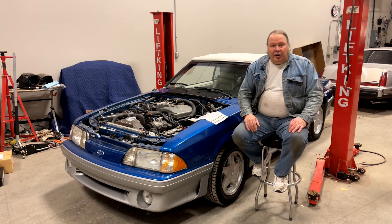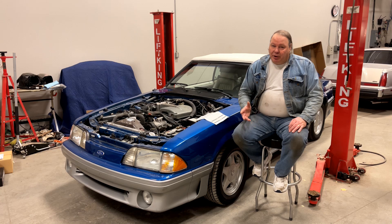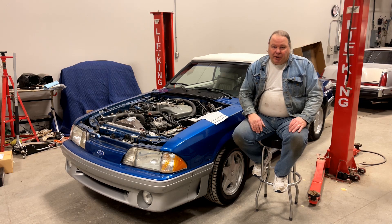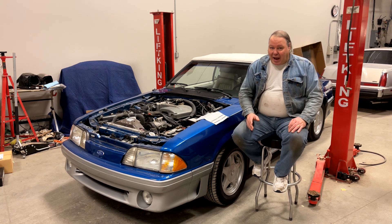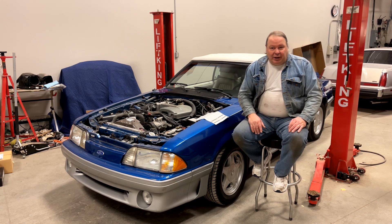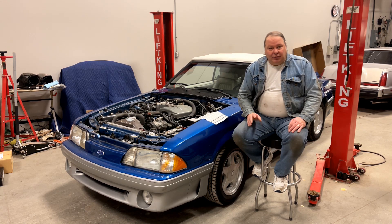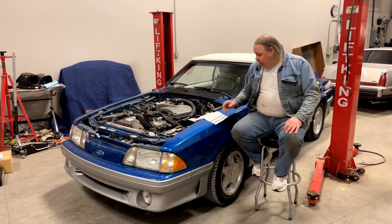Today's video is going to focus on upgrading the fuel pump wiring in a Fox body. If you're putting a large aftermarket fuel pump in one of these cars, you're just not going to get the advertised flow rate if you use the factory wiring. The factory wiring on these cars is 14 or 16 gauge, runs from the front to the back, then back up to the front again. There could be as much as 32 feet of that thin wire in the circuit, and the new fuel pump is going to consume a lot more amperage.